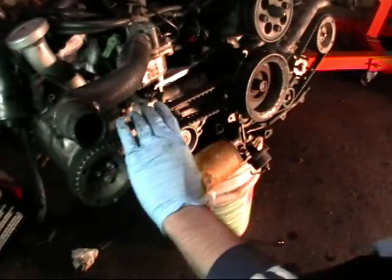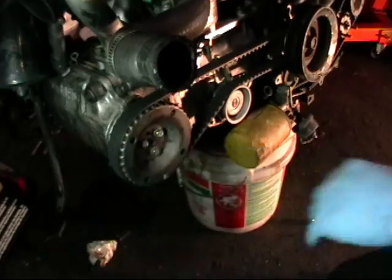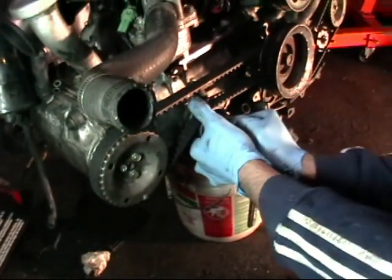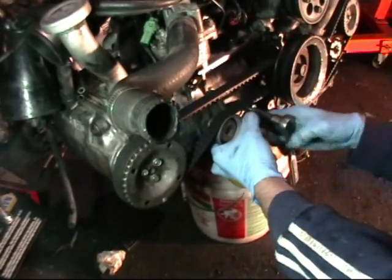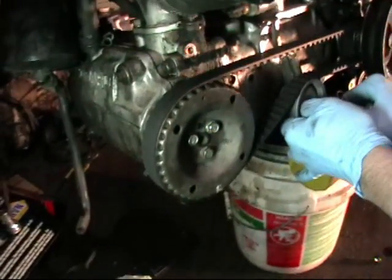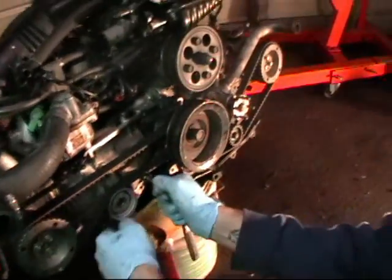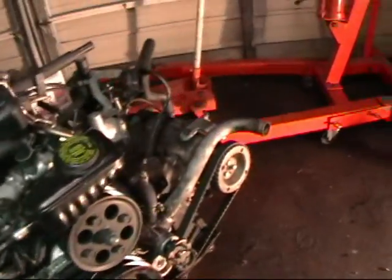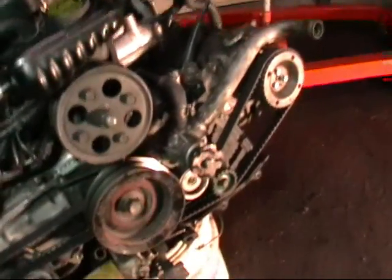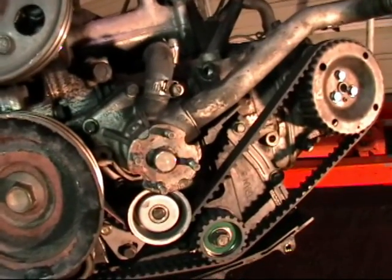This is part of the benefits of running with open belt covers. Since doing maintenance on your car is more likely anyway than the life of the parts themselves, you would have easier maintenance by not having as much time involved. Having the inner covers out of this timing belt allows you to grab onto that cam pulley and have full access to move things around, which really saves you a lot of work. It saves you from taking off the crank pulley, the alternator and AC assembly, and it allows you to do the water pump without touching any timing belts at all.